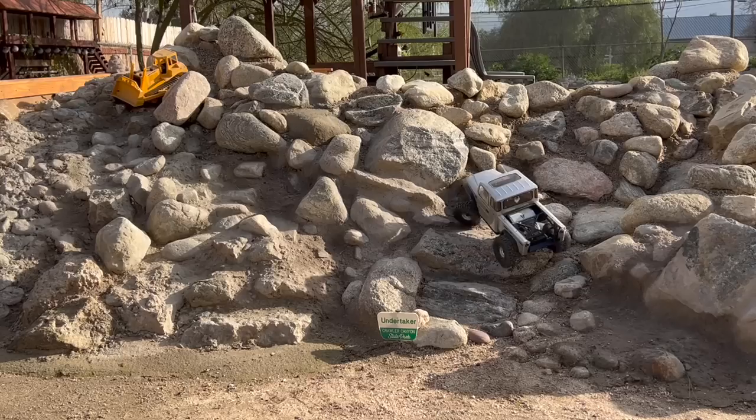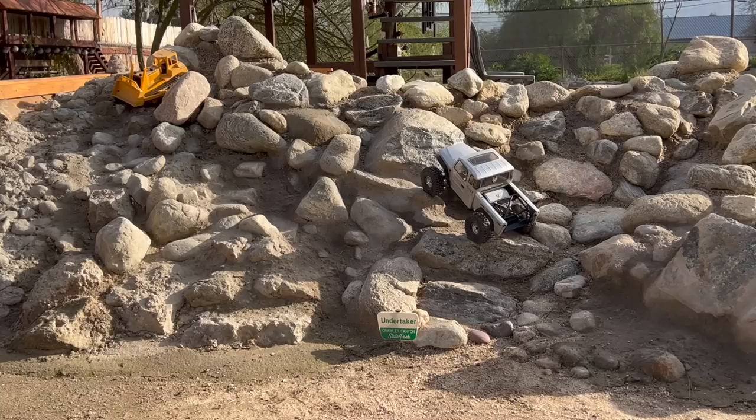The maneuverability is up, but I'm willing to quantify now that the loss of steering is just a loss of weight in the nose end. Like, my battery used to be right next to the servo. So no matter, all other factors ignored, 4 ounces is right off the top of the axle, has been moved. And that is going to have an impact for sure.